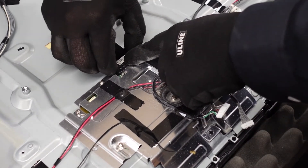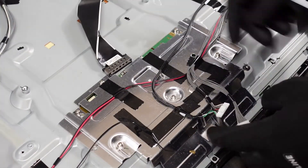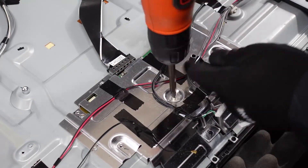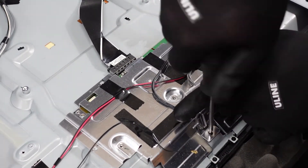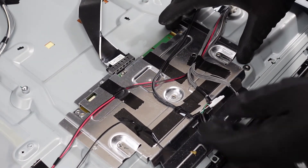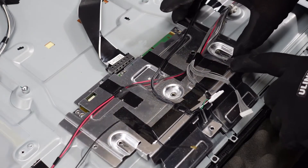Just squeeze them and kind of shimmy it out using both hands. Now it looks like we can go ahead and get these screws out. And that should be our housing — we'll just remove some of this tape and get these lifted off of here, then move this shield out of the way and see what we're working with. Once you have your tape removed, that way these cords can move around a bit more free. We're just going to shimmy these out of the way and get them out of your workspace.